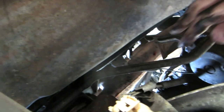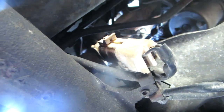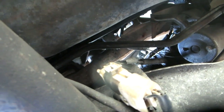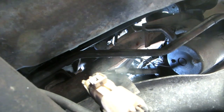Ring gear right there. It'll slide out this direction. It's not going to be incredibly easy, but I think I can reach up in here with the ratchet and get both that solenoid wire, with all the broken tape and crap on it that's falling off, and the positive battery cable, which is kind of hidden back around over there. You can see which direction it comes out with it laying in here like that. If I were to look at the back of it, it comes out in the 8 o'clock position or somewhere in there. Alright, let's see if I can get those things off of there.